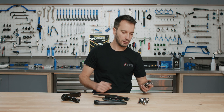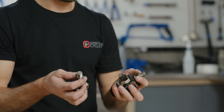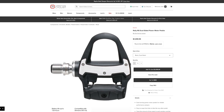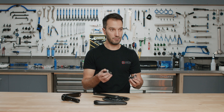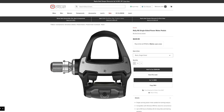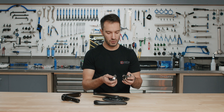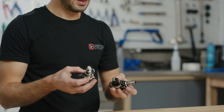The last option is power meter pedals. We have mountain-style power meter pedals here made by Garmin. These are also available in a road style with an SPD-SL three-bolt cleat pattern; this one uses the two-bolt cleat pattern. These give you left-right power. You can also buy them with a power meter in just one pedal — which multiplies by two like the crank arm and spindle systems — or with power meters in each pedal for true two-leg power.